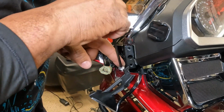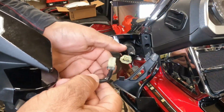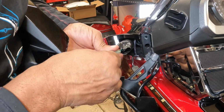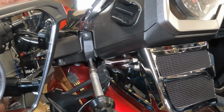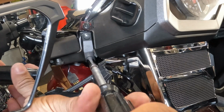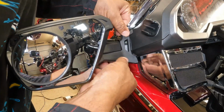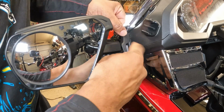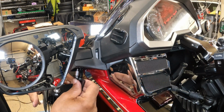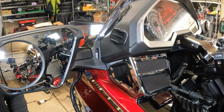The mirror assembly can now be reinstalled using a 5mm Allen. Reconnect the side mirror wiring harness. Tuck the black rubber boot inside of the void space. Put back the 2 bolts that hold the side mirror onto the Honda Goldwing. Replace the black cover that goes underneath. If applicable, secure the black cover underneath with a screw located on the bottom.